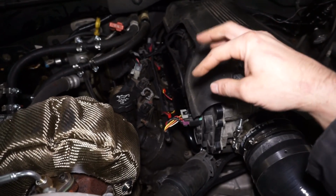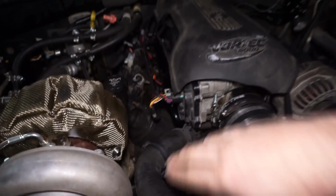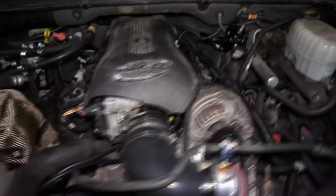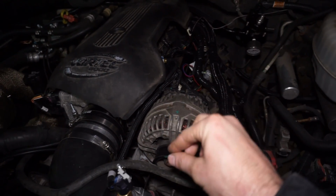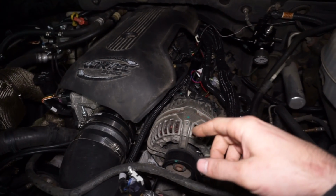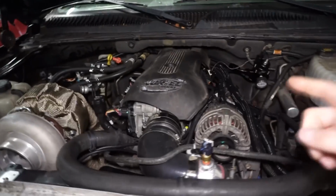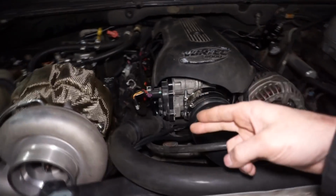The vacuum line that I had plumbed into the boost valve was teed into my bottom wastegate line, and that was fine before because it was getting 100% reference. But then I added my boost controller and split the bottom line, and then I added another line to the top. So that valve wasn't getting 100% boost reference.